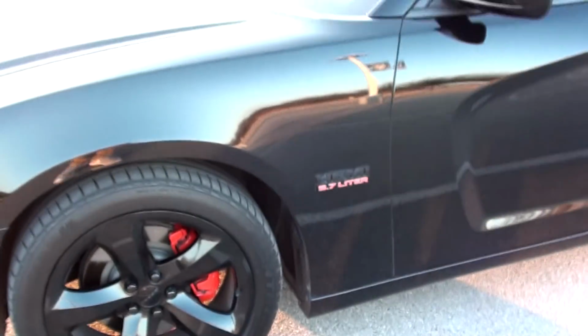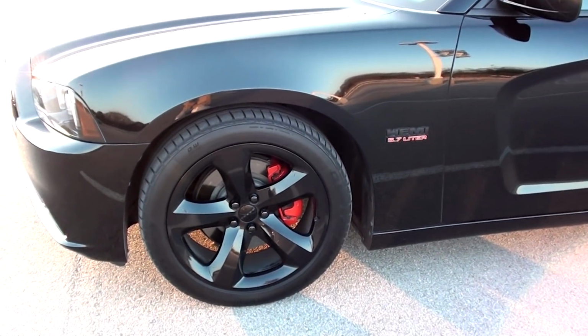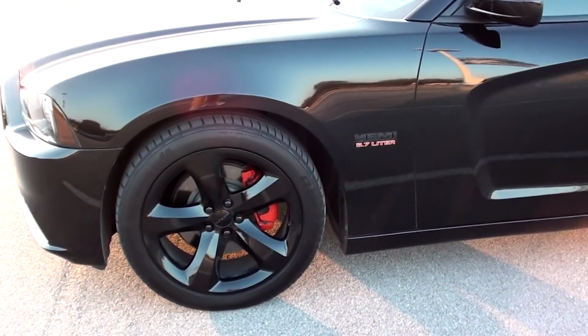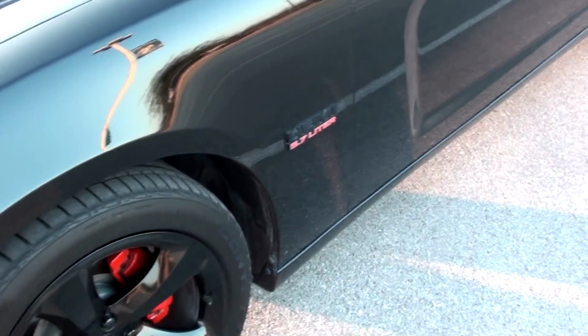But if you go right here, the D and W, apparently when the W goes away, that's when they're not safe to drive in the wet, and when the D goes away, it's not safe to drive in the dry. So as you can see, they never were a very deep treaded tire to begin with, but they're showing signs of wear already. I think I can probably manage to squeeze out 25,000 miles out of those. I doubt it can go any more than that.